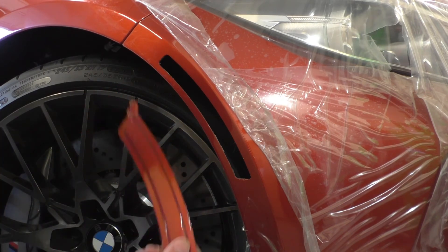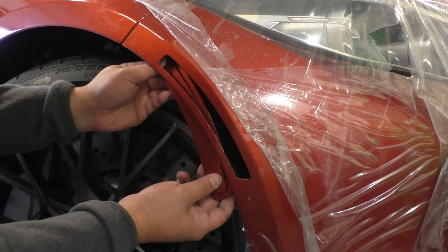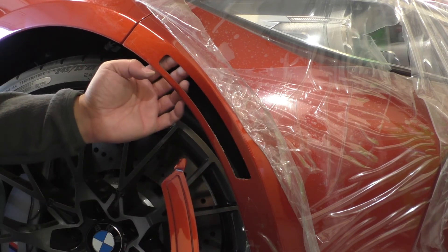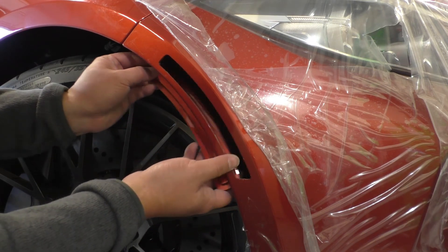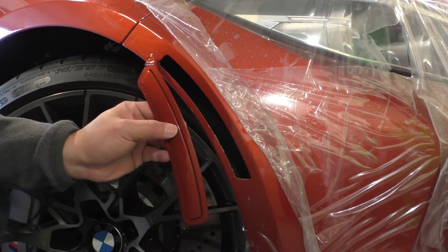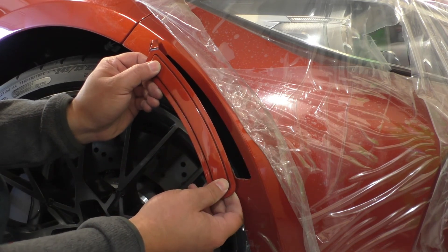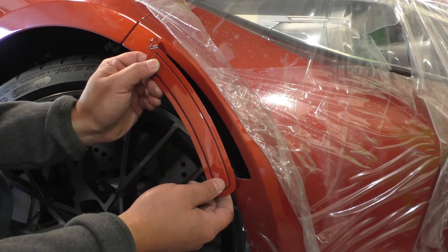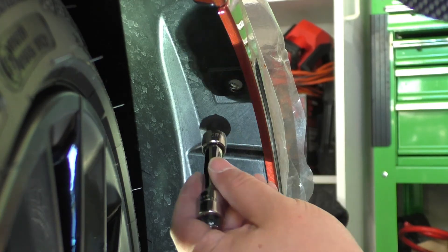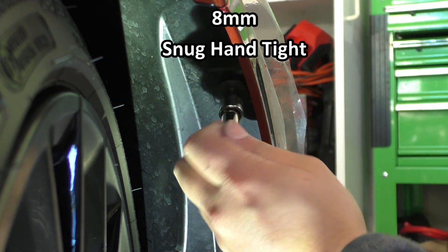Now if you're installing the deletes right away, you peel this off to expose the double-sided tape and then slide this in and install it just like that. I would start with the top side because there's less flexibility in the material there — get it started, then rock it in and do the bottom. This leading edge does fall a little bit behind the wheel well liner, which is why I pushed the assembly back so everything was accessible without having to peel back the wheel liner. Don't forget to put your 8mm screw back in for the wheel well liner — just hand tight and snug.